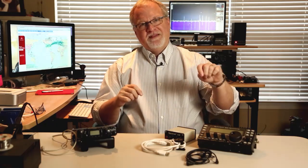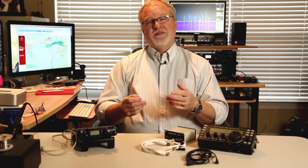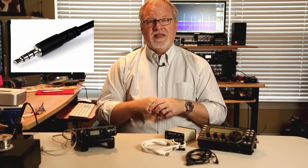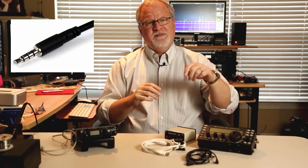The other side of that cable, the side that has to get that audio signal into your computer, probably has a mic input jack or a line in jack. If you don't, some computers, especially laptops, will have a headphone jack that actually supports 4 conductors, with the 4th conductor being audio in. Now this works for headsets. You'll find headsets used for Skype and that kind of thing, voice over IP applications, that have a little 3.5 millimeter jack with 4 conductors, tip ring ring sleeve. So it's possible that your laptop actually doesn't have a mic input, but that the headphone jack will allow audio input.